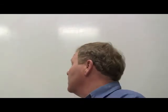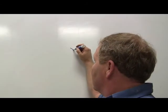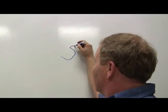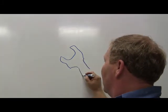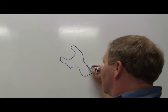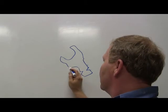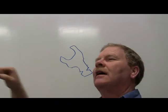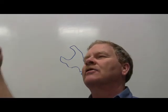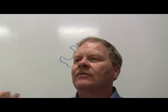One of the things I did to get those, I got me a really good wrench, a 7/8, and I'm not good at drawing a wrench, so bear with me. I cut that wrench off about that long, and I cut a notch in it on both sides, like that right there. I would put that on the oxygen sensor, find a way to get my big pry bar against it, and break it loose like that, and then you can usually screw it out with your fingers, unless the threads are all shot. See what I'm saying?